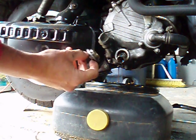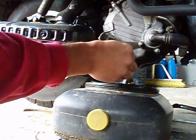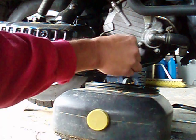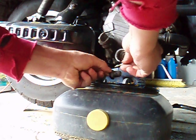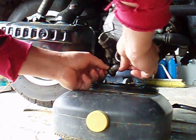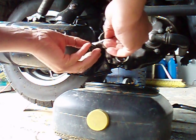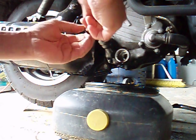There's a spring — the big side goes in towards the wire filter. Just like an old Volkswagen Beetle, it's great: you don't need to buy filters and throw them away, you can just keep reusing this one. The reason I have a Q-tip here is to check it and see if there are any little metal filings on there. Let's see if there's anything else weird in there — it's nice and clean.